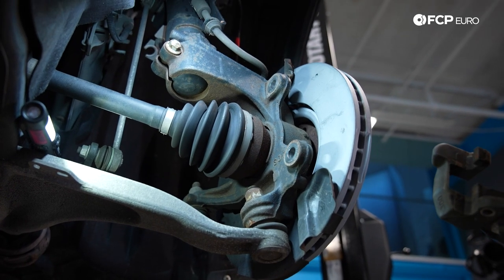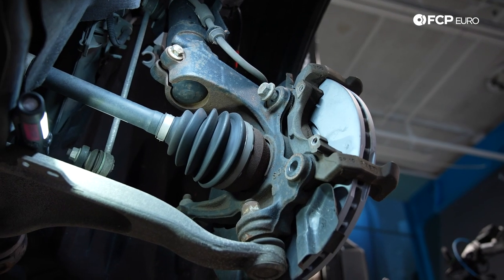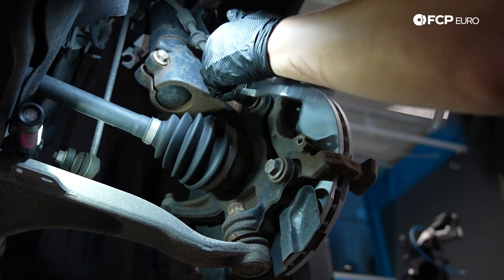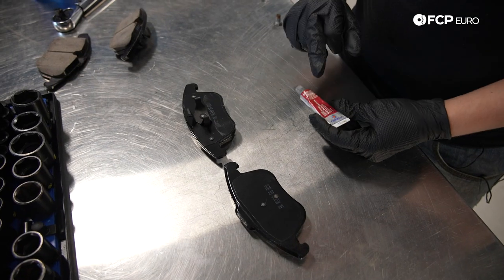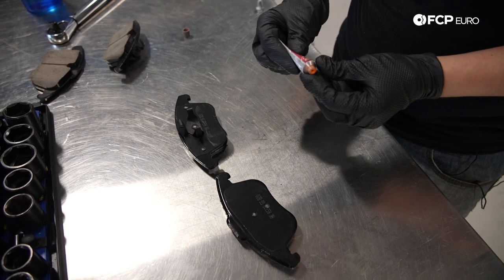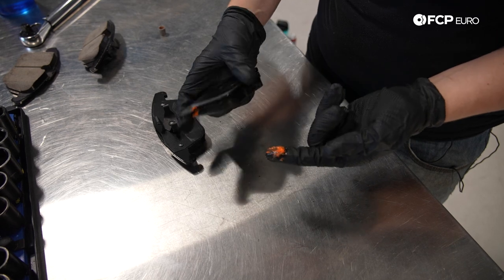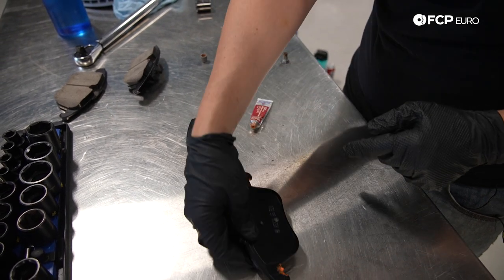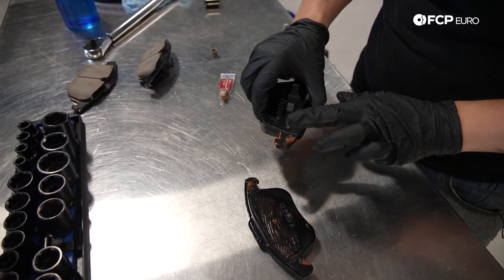At this stage we can replace the caliper bracket. I like to use a little bit of thread locker on these bolts. Volvo usually specifies new bolts because they put thread locker on from the factory. The main torque on these 18 millimeter caliper bolts is 200 newton meters, which is pretty high, but that's the spec. I'm using a silicone ceramic brake parts lubricant from Permatex — it's safe for all plastics and rubbers. I'm going to apply a little bit to the back of the pad and the mating areas where the calipers slide on, making sure not to accidentally touch the friction material. Put a thin coat on the back where it's going to contact the caliper bracket, then do the same thing on the other side.